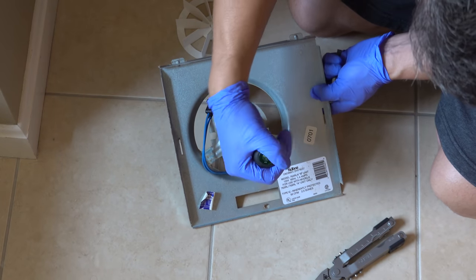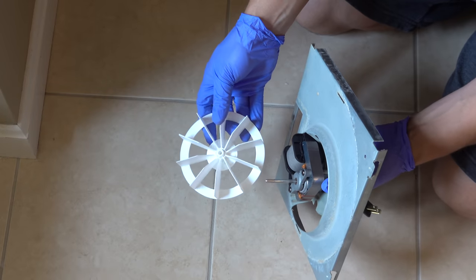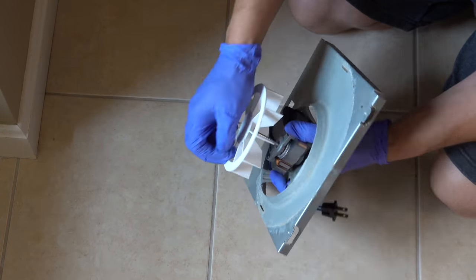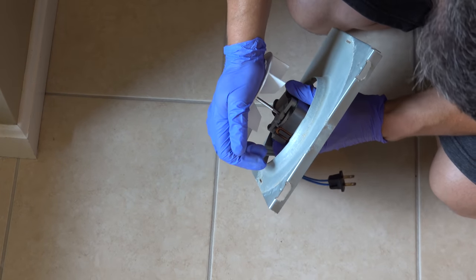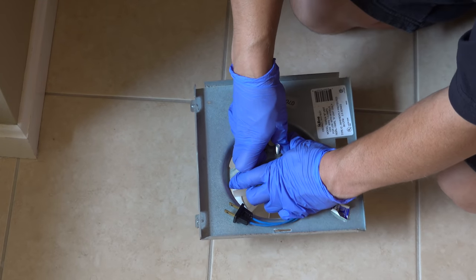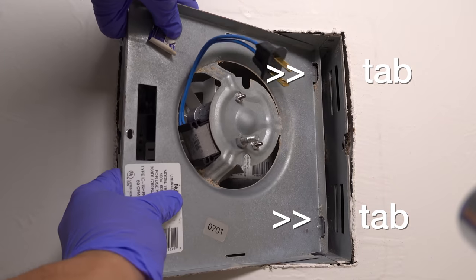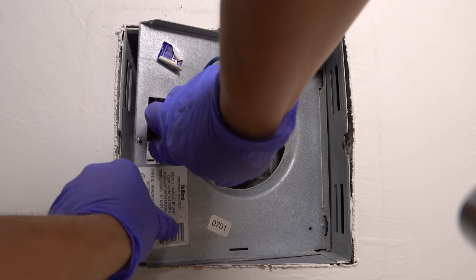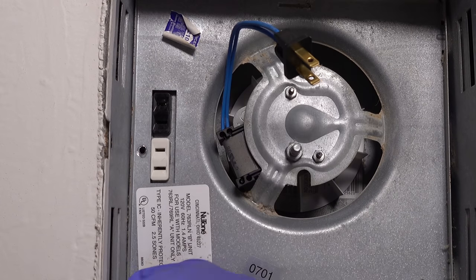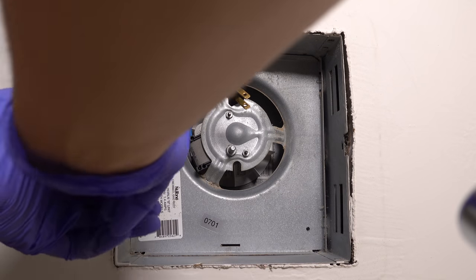Now we just need to install the fan assembly onto the motor itself. You don't need any tools for that — it actually just presses on. Once you get it started onto the shaft, I find it's easiest to put it on the floor and then push it from the back of the motor down until the shaft goes all the way onto it. Make sure you refer to the directions that come with your kit in case they tell you to place it differently. Now reinstall it into the housing — it's got those tabs on one side, you line them up and press the opposite end in, and you can see the screw hole lines back up. Tighten up the Phillips head screw and now everything's mounted; you've just got to plug the cord back into the socket.